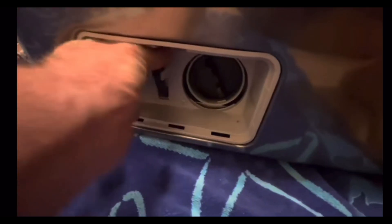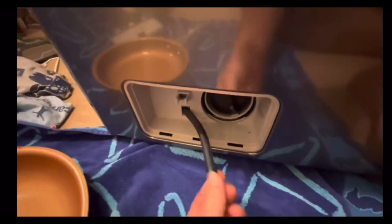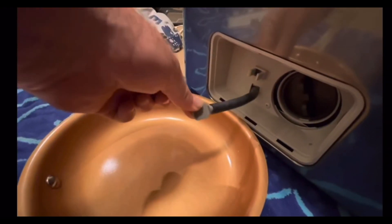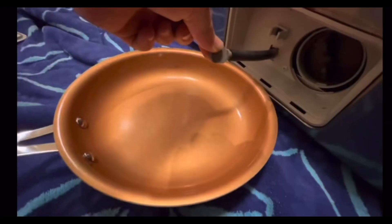There's a trick to it. We'll take out the hose, gently pull down and gently pull out a little bit — but that's all the hose you have. So you can see that if you had something tall like this, it really wouldn't work. We're going to put it into this pan, fill it up about halfway, and then keep kind of dumping and coming back to it. I'm just going to pull out this plug and drain out the water, and then we can put this plug back in temporarily if we need to go dump out the water.